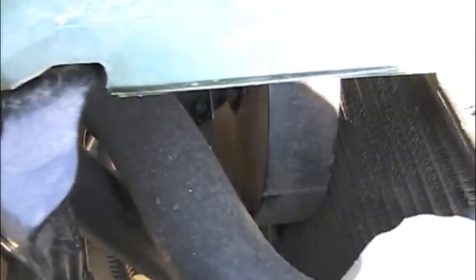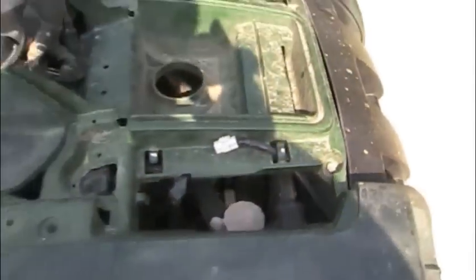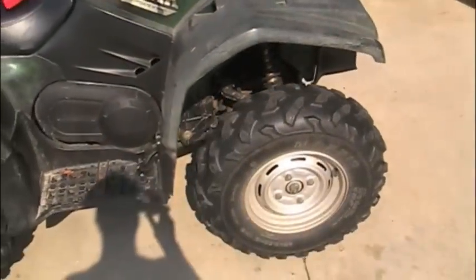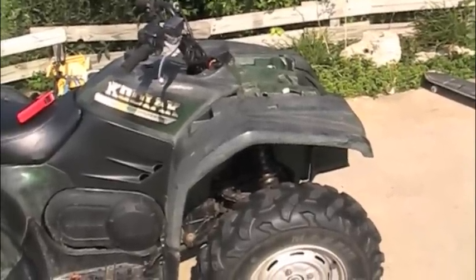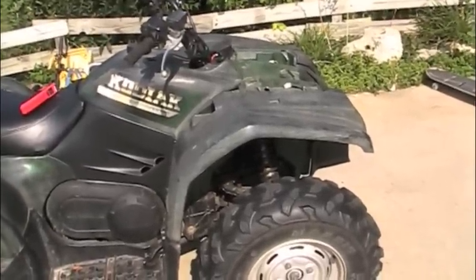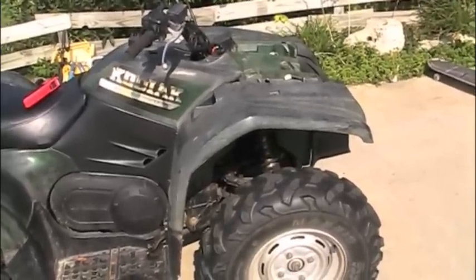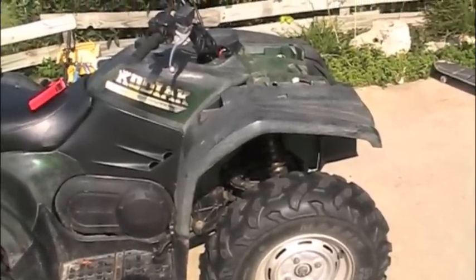You can hear it in there. It's in there and it's running slowly — there you can see it. And it just shut off. So I got quite lucky with my overheating problem. It's got a thermostat, coolant fluid in the radiator, a cooling fan, and an electric controller to turn the fan on and off. It turned out to be just a stuck fan motor and I was able to break it free, put it all back together, and it worked. I hope yours works out fine too.